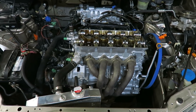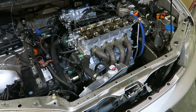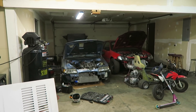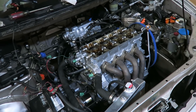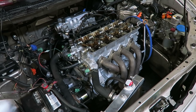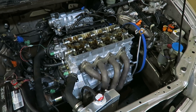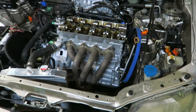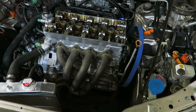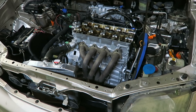We're also going to try a heavier weight oil. Right now we're running 10W-40 in the van. My hatch runs 20W-50 and I see much better oil pressures there, so the thicker oil should help bring up the pressure. Hopefully shimming it will do the trick, and if not we'll have to change out the pump as well. If you guys have any ideas of what it could be, please let me know in the comments. Right now the van just cruises a little low — it won't come above 60 psi at any RPM.